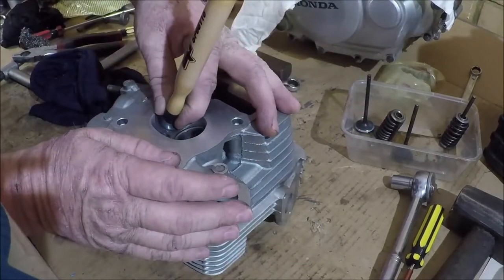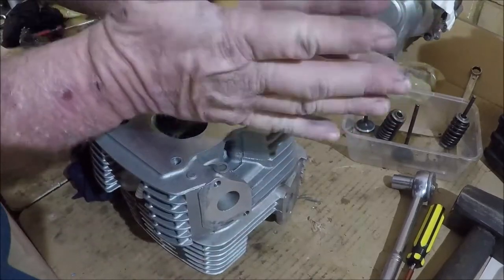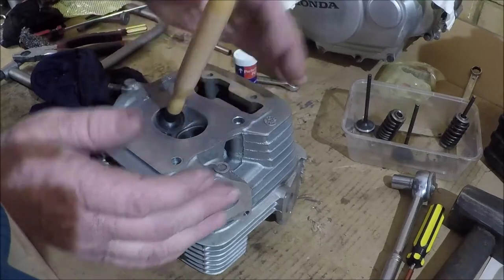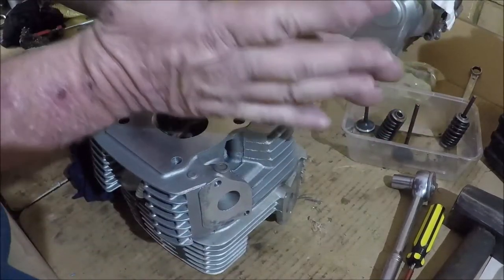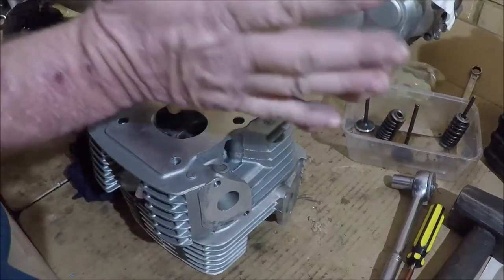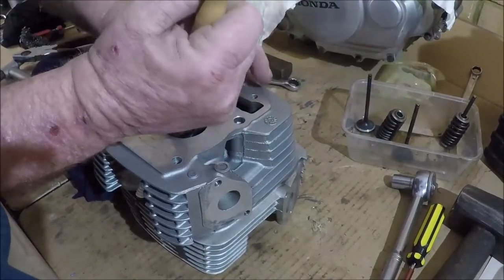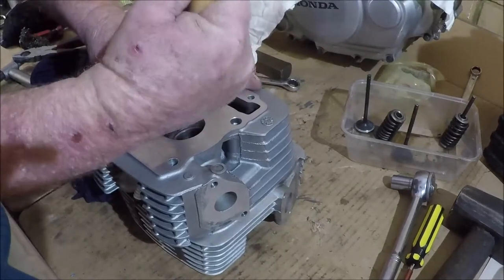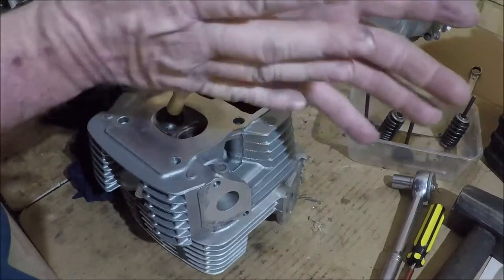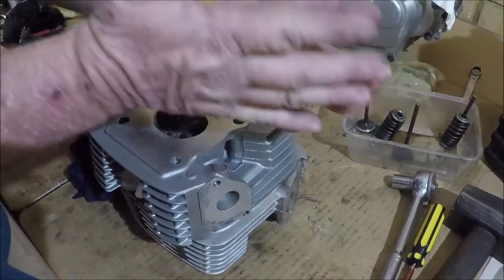And we're always pulling it out, by the way, and rotating it about 60 to 90 degrees. As your engine runs, the valves do rotate. In fact, if they didn't do that, they'd probably burn out quite quick. Some engines, the six-cylinder in a Toyota Land Cruiser is a prime example, actually have built-in valve rotators, part of the valve train to force the valves to rotate.